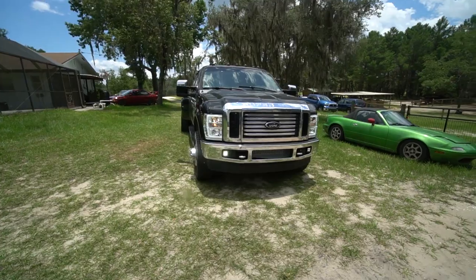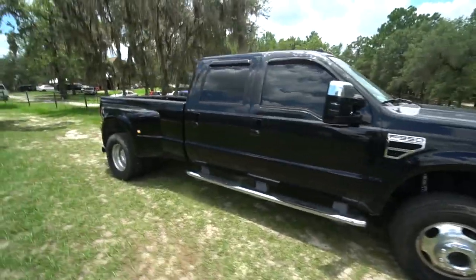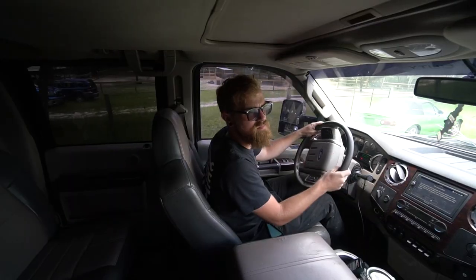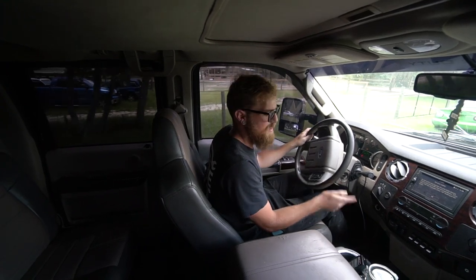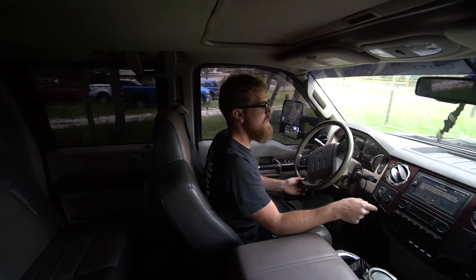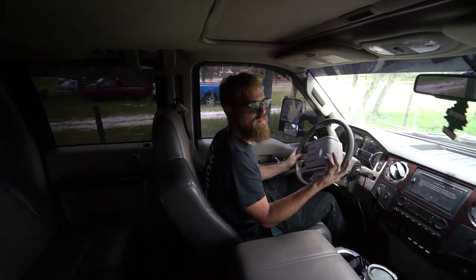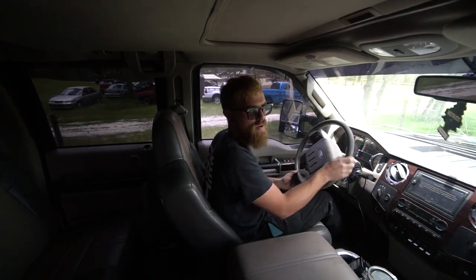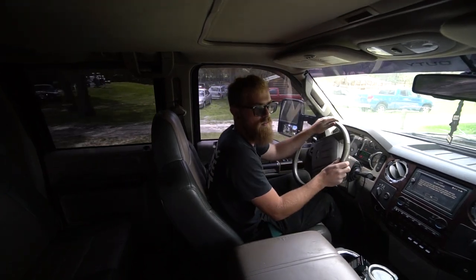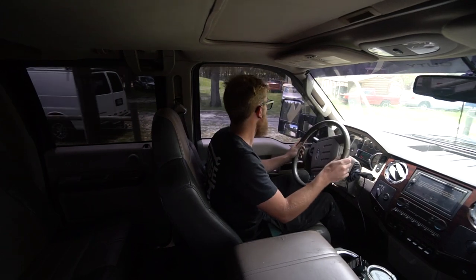There she is outside. I did discover one of my taillights isn't working — I think the plug's just backwards because it can go either way. But the one that is working looks good. I really think what that noise is coming from the engine bay is the engine touching the firewall — that vibration is transmitted through the sheet metal, making it loud in the cab. Because if you listen to the engine bay, there's hardly any noise at all, a lot less than my old Cummins truck.